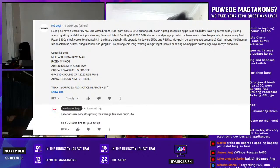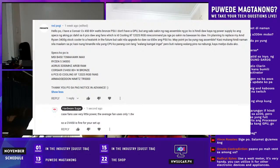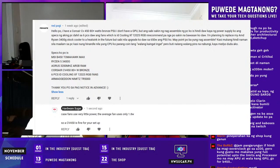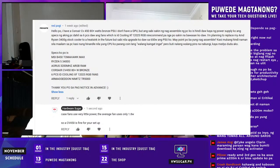Possible. Get a fan hub, and you're okay. The fan hub usually just connects to a SATA, like the Deepcool, or sometimes a Molex. Probably cheaper than a more expensive power supply. But yeah, benefit of the doubt, I don't know who the shop is, he did mention, so there could be use cases where you need a different PSU, not the 450W one. But still very dubious for me that that would be the advice, just because he wanted to stick in 6 extra fans.